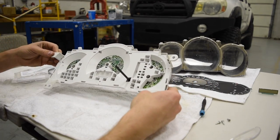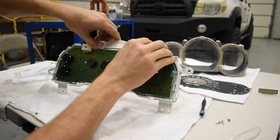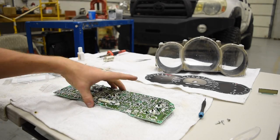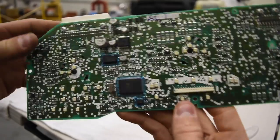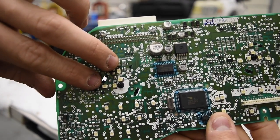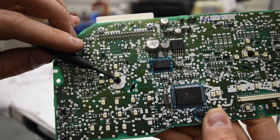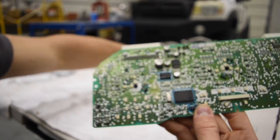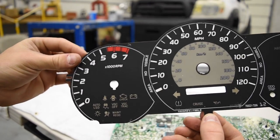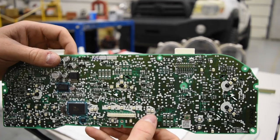Once that's all off, pull off the plastic trim piece — be careful, don't let it break. There are little tabs on each corner; pull them up and pull on the motherboard piece and it'll pop straight out. Set the white piece aside. Now you've got this — this is where you're going to do all your work. Just focus on the little LEDs. The two outside LEDs do your RPM numbers, and the two inside ones do your needles. Down here are your odometer lights and your blinkers.